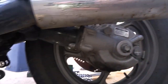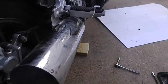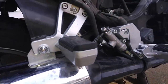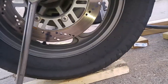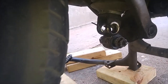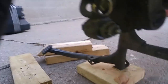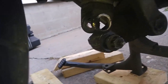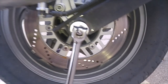So that worked pretty well. Hopefully I'm not straining anything letting it sag down that far. I got the exhaust system put back together and the clamp tightened down. I put a 2x back under the rear wheel because it wasn't quite touching the ground — I didn't want to be wrenching on it. I also put the bolt back in to this piece here because it had exposed greasy needle bearings. Having that shoulder bolt back in there will help keep stuff from getting in there.